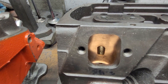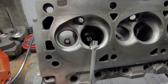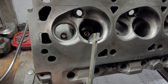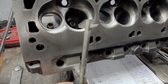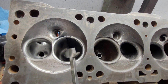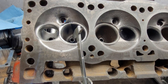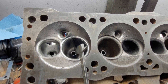I'm not thrilled about the Trick Flow exhaust port. I'd rather have an oval than a rectangular port. Someone will say you need to compare CCs, but they're different designs — to illustrate, the distance from the edge of the short side to the flange is much shorter on the Trick Flow. You can't go by CCs; you have to go by how much area it has.